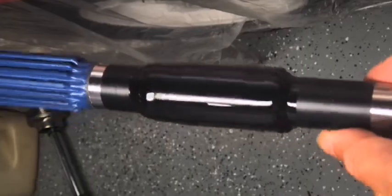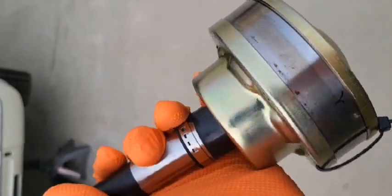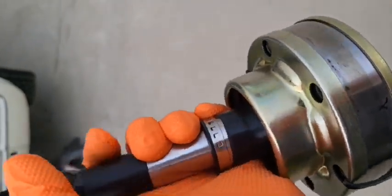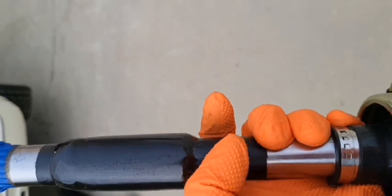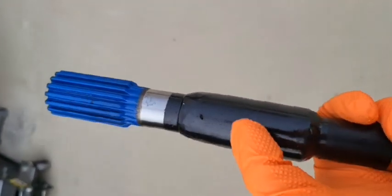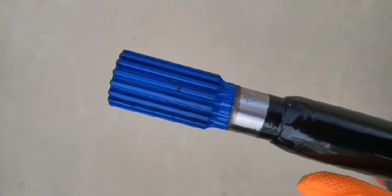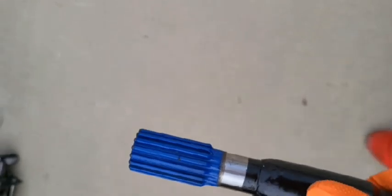This one turned out pretty straight. So this side is the Porsche high-speed boot and the 108mm Porsche CV. I cut that axle shaft and mated it to this, welded it in the middle as mentioned, put the sleeve over and then welded that. It'll go to a slip yoke to a universal joint, and we'll see if that finally takes care of all the vibration.